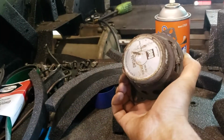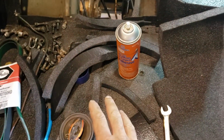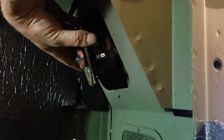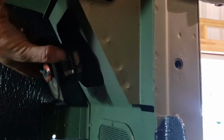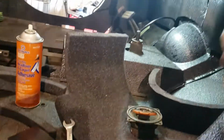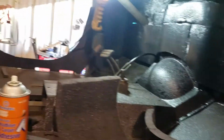I found a place to mount these damn things, and you can't even see them. Check this out. Without the dash in here, and you know, for you to hear the speaker, you don't have to be able to see it. Look right there. The hole in the back of the cowl, right where those 2 bolt holes are, that's where the mirror bracket bolts come through. You can mount this right there. I need to make a plate, or 2 plates out of sheet metal, cut some holes in them for the speakers, mount the speakers right there, and if you look right here, you can run your speaker wire through right there, or you can just go over on the top in some insulation and some loom. So that is a new one. I'm glad I saw that. It's going to give me a place to mount those, and that way they're not falling off the firewall and getting under my pedals while I'm driving, because that got really old.